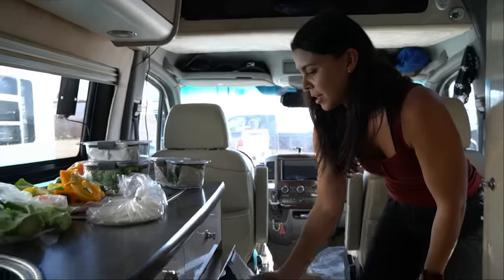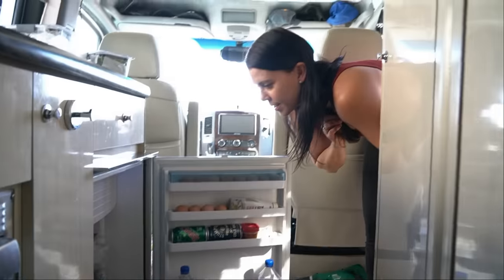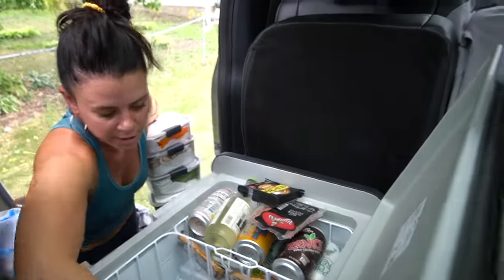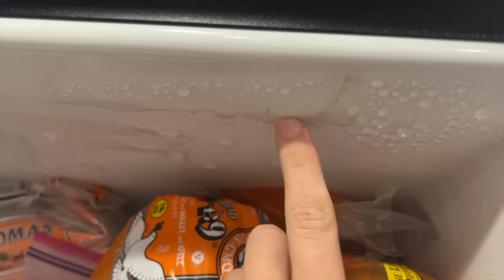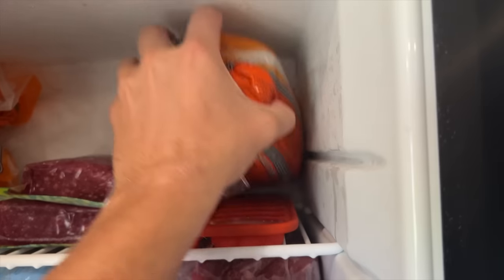When we were in our van the first three years of RV life, we had a 12-volt fridge, so we know we like them. We also used a 12-volt fridge during our vehicle-based overlanding stint living in our truck and rooftop tent. Getting into this travel trailer was the first time we had the gas absorption fridge. We saw it start to struggle most in the Florida Keys in April and May — hot, sweltering, a lot of sun, heat, and humidity. We saw a lot more spoiling greens and the freezer struggling, icing up really badly with inches of block ice dripping water in the front.